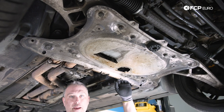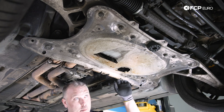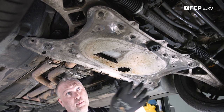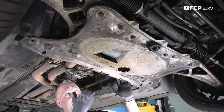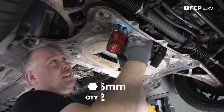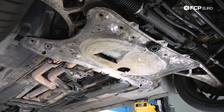This is a very high mileage E46 M3, and being as such, it is not perfect — it's missing some of the underbody pieces. I'm going to start by removing the reinforcement plate. The reason is I need the whole transmission and engine assembly to tilt back, and it won't do that if it's sitting on this. So 16 millimeter bolts — we're just going to pull all those out, get that out of the way, and then move on to start removing the exhaust.